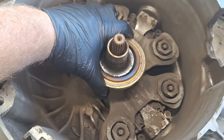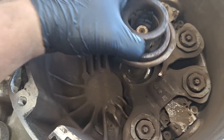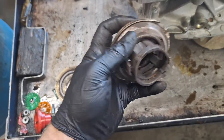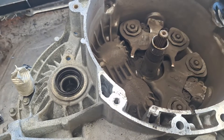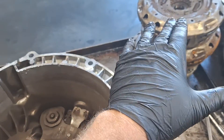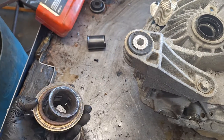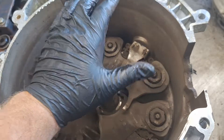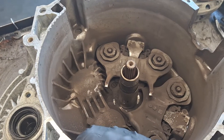See if it comes out at all — yeah, it does. That bearing was about to explode. That P2700, I believe, is just a general performance apply time code for the clutch, and I think it's a combination of things: a catastrophic clutch failure with a spring in the bell housing at the back of the engine — whether or not that came off of it, I'm not sure — and obviously the bearing is coming apart. I'm sure the forks were gummed up, and they are original with 125,000 miles on them, so they definitely need to be replaced while we're in here.